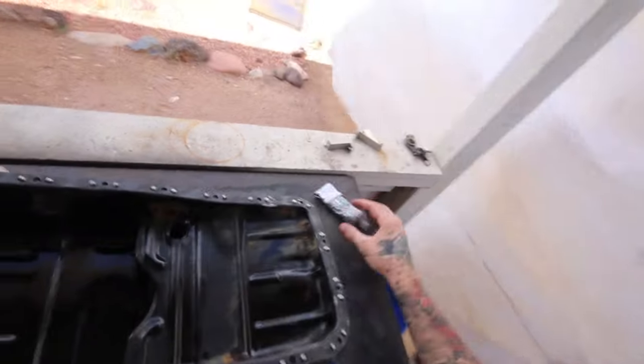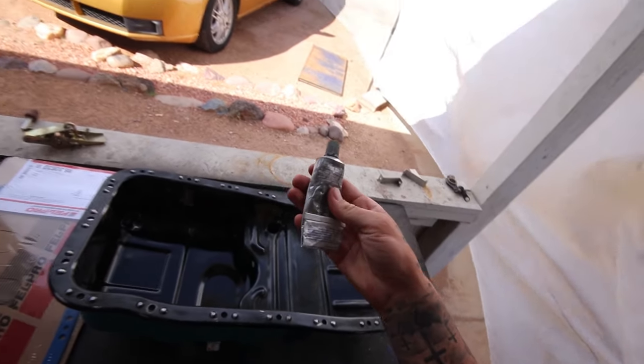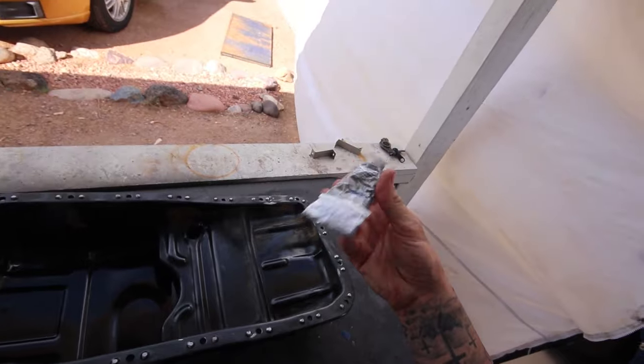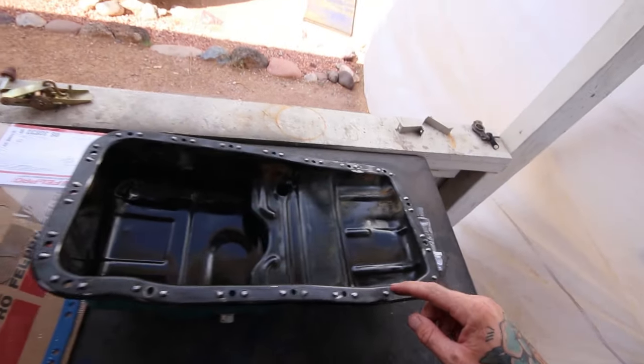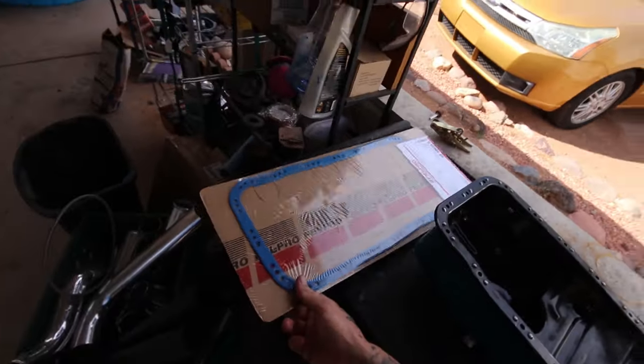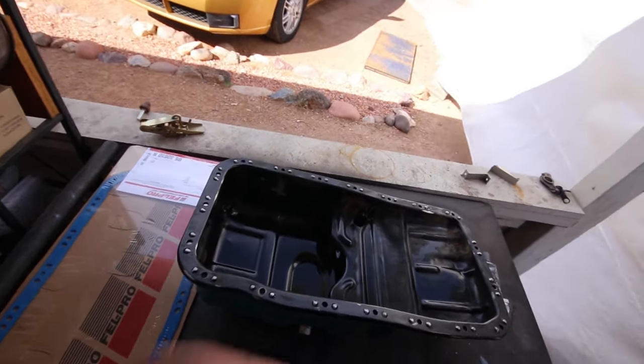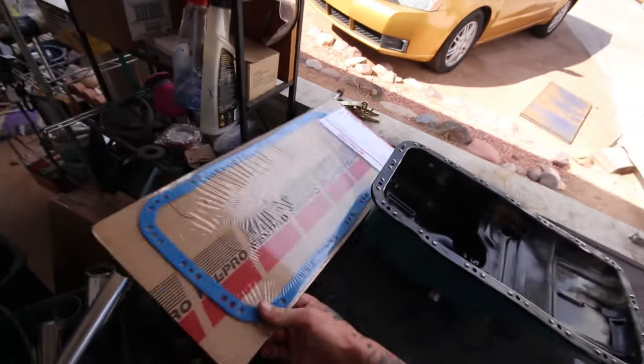Got the oil pan off. So I'm gonna go ahead and just stick some of this, which is basically just off-brand Honda Bond that you get from like O'Reilly's. It's Permatex Ultra Gray. And yeah, just go ahead and stick some in between here and in the corners, so that way the gasket hopefully stays. I've never had good luck with oil pan gaskets, no matter how I do them, so probably gonna have to end up redoing it anyway. Yeah, try and slap this on quick.